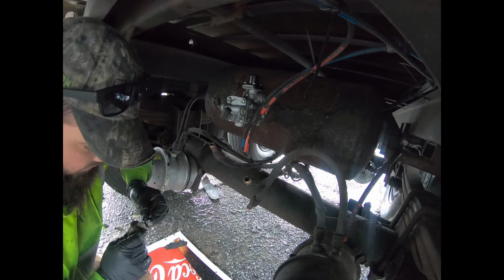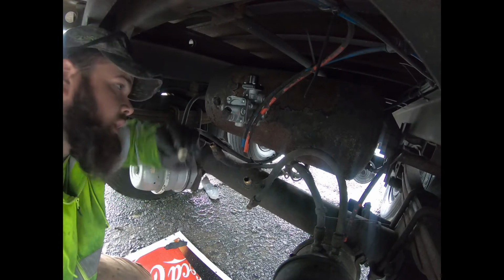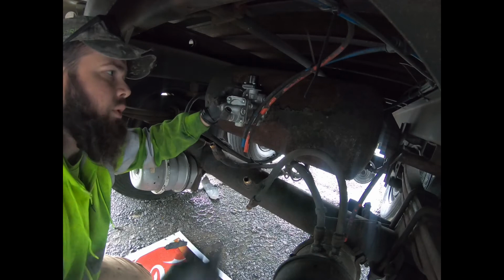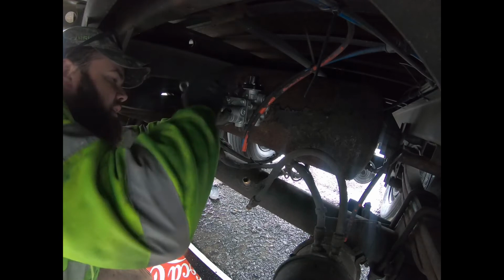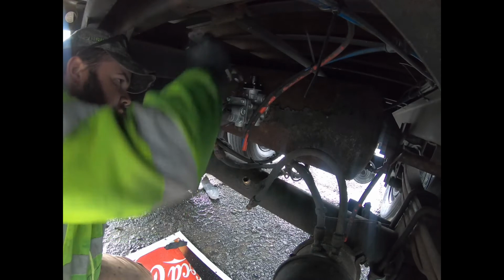Again, a little bit of pipe sealer, thread into our hole. Now what this is for, the reason it has two holes, is so you can have a tank supply off either side. So there's some applications where you can't have a tank supply to the driver. You may need one coming to passenger. So you could put a plug in the side you don't use, or even, if you're running multiple tanks, you can run to more than one tank.